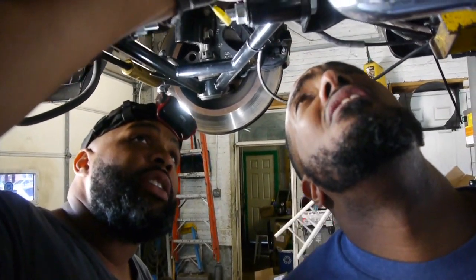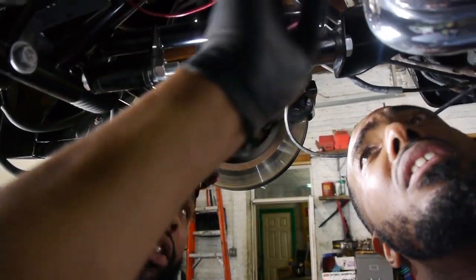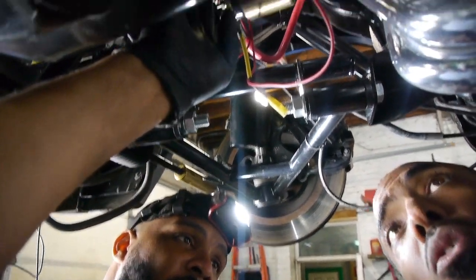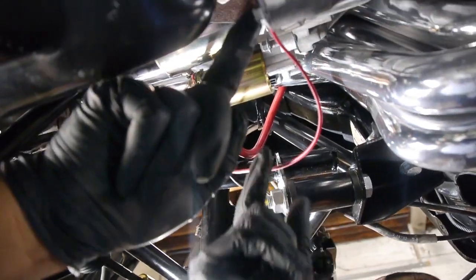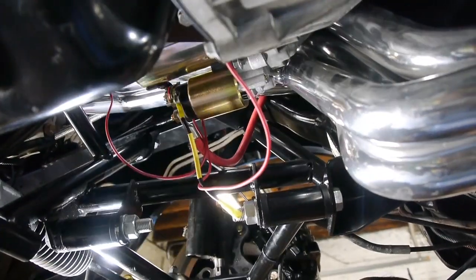Where it presses here against this, uh-huh, that's where it's grounded at. Right. So if this isn't grounded well, that's where you get your non-starting issue. So where do you suggest we put this ground? You can put the ground right there. So you see he had it here, but it does not go to the starter. Go straight to something else.